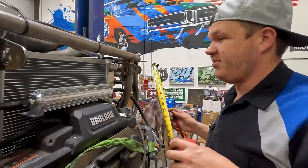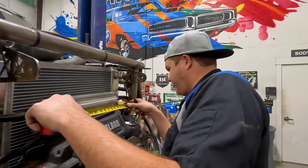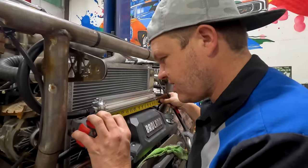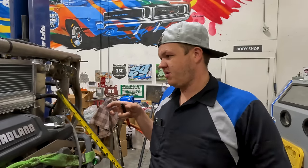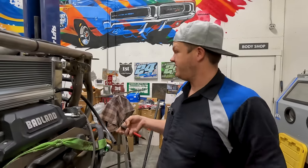Now, I have a sheet of 3/16 on the plasma table, so we're building all our bracketry out of 3/16 because I don't wanna go change the metal. So it's gonna be a little overkill, but that's fine. So I'm gonna build some cardboard brackets on both sides, make sure they work, and then we'll go to the plasma table and we'll cut them out, we'll weld them on, we'll mount that.